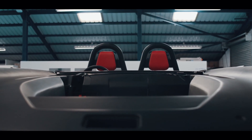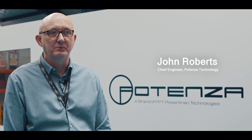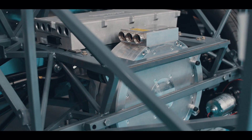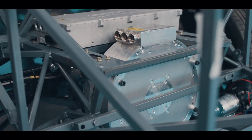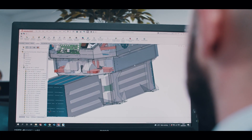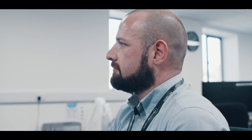There are particular challenges in trying to put 88 kilowatt hours of energy storage into a very small sports car, with particular physical packaging challenges. In this design, the motor and the other drive components are at the rear of the vehicle, and this frees up the rest of the vehicle for packaging cells. In order to make the most of the space, we wanted to get the batteries underneath — or at least one of the batteries underneath — the floor of the vehicle.